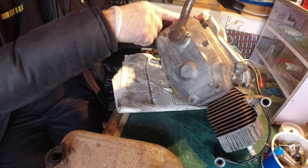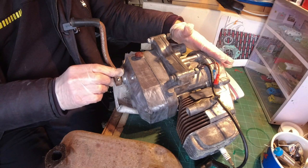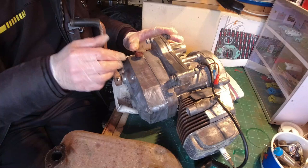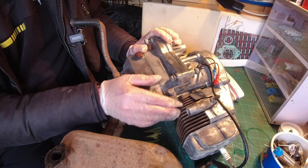I'm going to take this off. This is the gearbox bit with the oil in, and this is the electrical side. I'm hoping to powder coat that with a nickel silver finish, and the same with this one. I'm also going to take the head off. The bearings seem very smooth and the piston looks very good from looking through the exhaust port. The head can be sanded down and I'm going to paint it with some heat resistant paint.